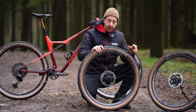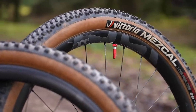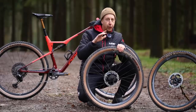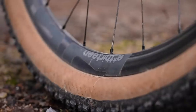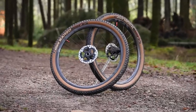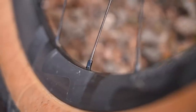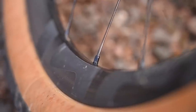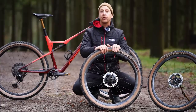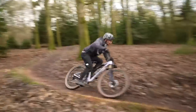E13 offer their cross country wheels only with carbon rims, but they have two models. They have the XCX Race, which comes in a 24mm internal width and also a much bigger 28mm. The 24s offer the XC thoroughbred riders — these are pure race wheels. If you're a light rider looking for the lightest bike, this is what you want to consider. You've got 24 spokes on the front and 28 spokes on the rear just to keep a bit more strength. The spokes are the DT Revolution, the lightest ones they offer, and having nice lightweight spokes also offers compliance — something you can lose with carbon rims. Compliance on a cross country bike gives you traction and comfort.